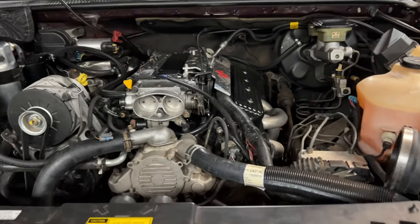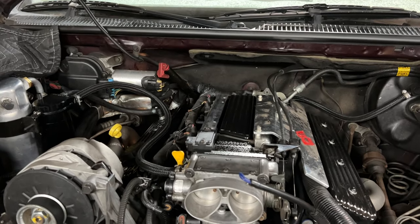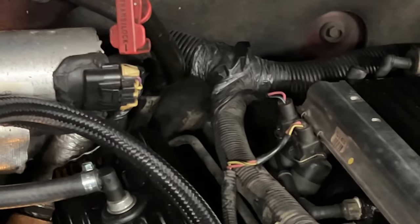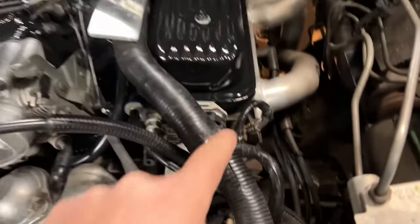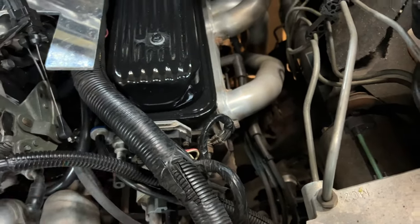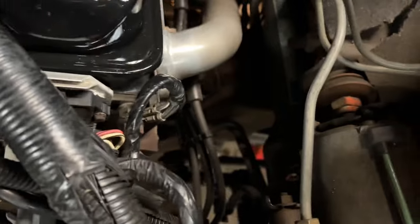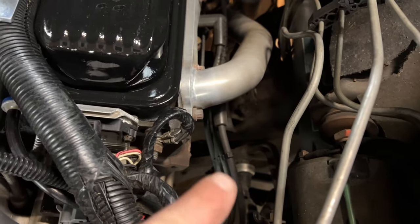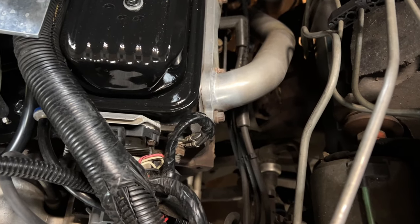Here's where I've made it to on the top side: the intake is off, the fuel rail cover is off. There's a hook back there that we're going to tie the engine hoist onto as one lift point, and I'll take the ground bolt off and put one in there for our second lift point. Down below, there's a wire — that's the power steering warning wire — and I've got that unhooked at this point.